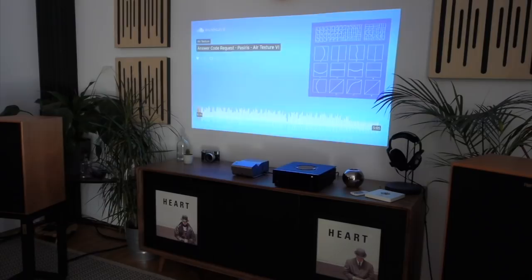The screen on this LG projector is more than satisfying for me — I'm really happy with it. It has a 3.5mm headphone socket which spits out analog, but its internal DAC is pretty weak, so I can't really use that. It has a Bluetooth output but it's only SBC, which again sounds pretty weak. So what we need to do is get the digital audio out before it goes into the projector.